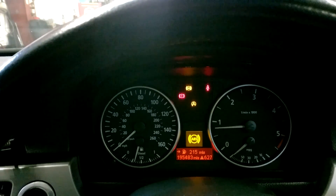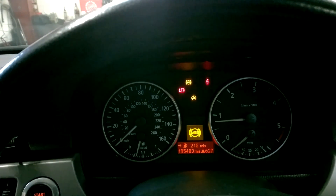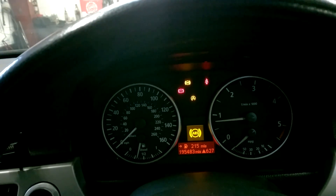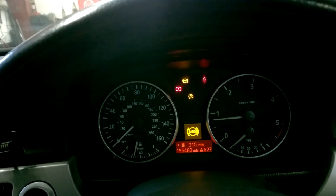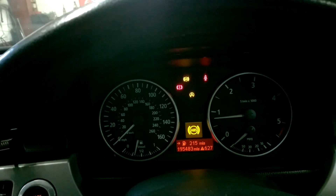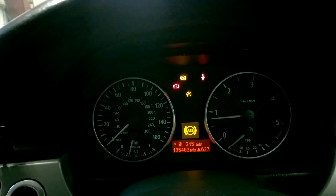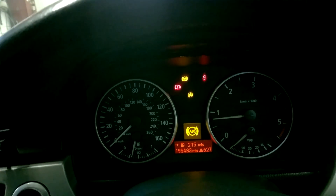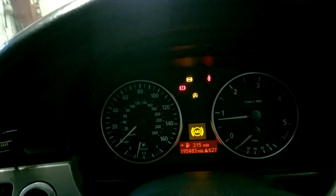Welcome to today's video. As you can see, I have ABS warning lights, traction control and brake warning lights on. This is a follow-up from a previous job — the car came in with issues with the right-hand rear wheel speed sensor not picking up signal correctly. After the work was done it went away for a considerable amount of time, but it's back on again. A road test with live data showed the signal was intermittent on the right-hand rear again.